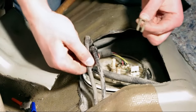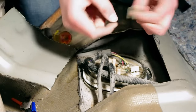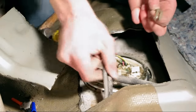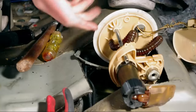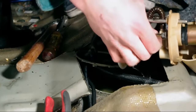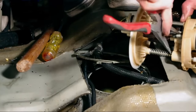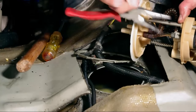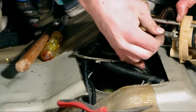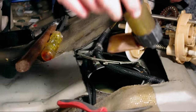You're going to have to disconnect the fuel lines to get it out. Ford and Mercury make these little clips — basically just push them from one side, pull on the tab, and it comes out, then pull the tubes off. Now that you have the thing out, take those three screws out, the motor just pulls right out. It's flush and automatically seals into a pickup tube. Stick something in that little line to release the electrical connection, and there's your motor. Throw the new one in and put it back together.